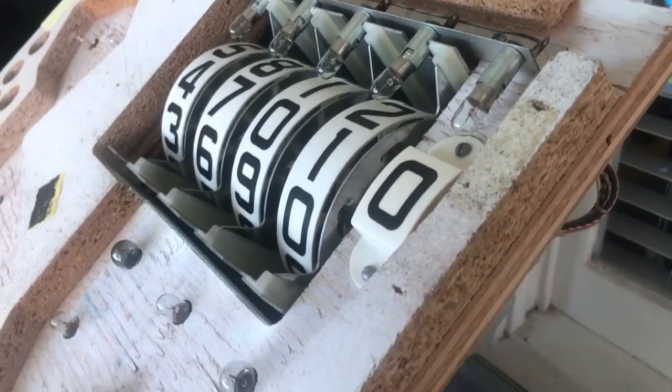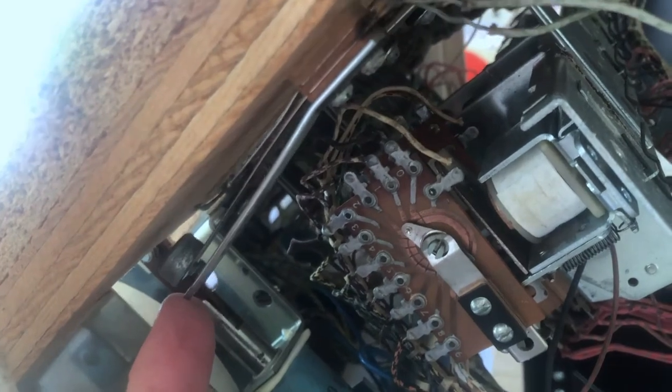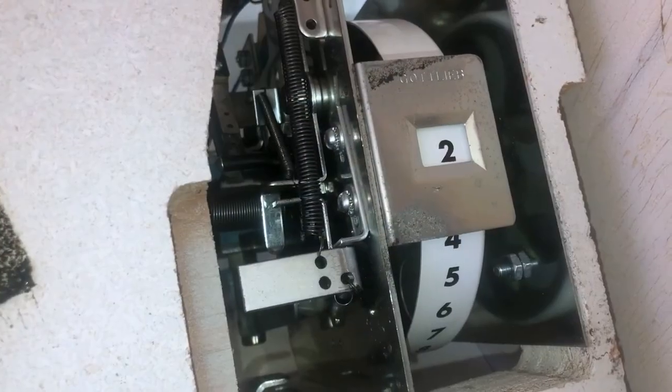Sixth and finally is inside the head. I've got the backboard open on this game, and you can see right here on this front edge there is a switch. This is also an anti-cheat switch — normally closed — and same thing, it vibrates open and the game ends. It's just a good thing to know where these are on your games, especially when you first get one. If you're having an issue with it starting up, there's always a chance that one of these switches is misadjusted.